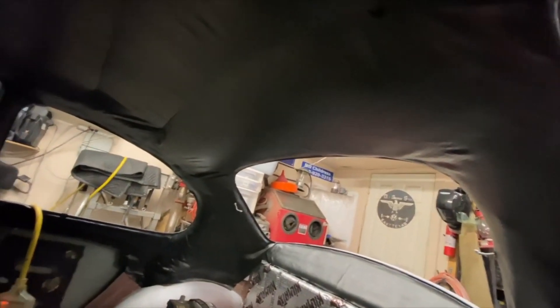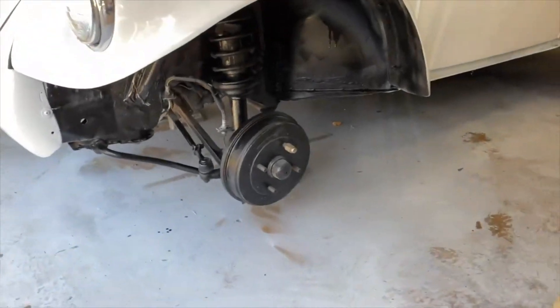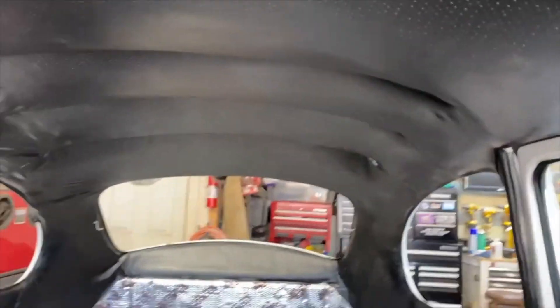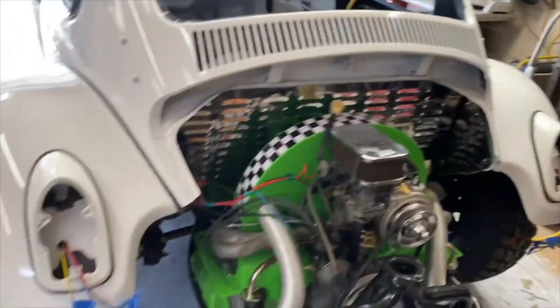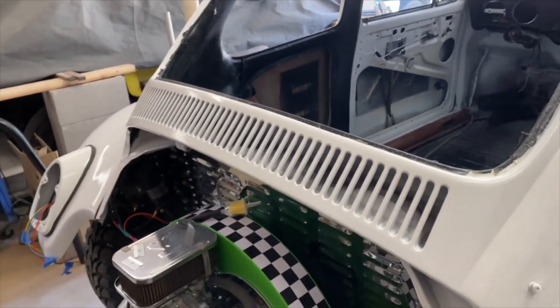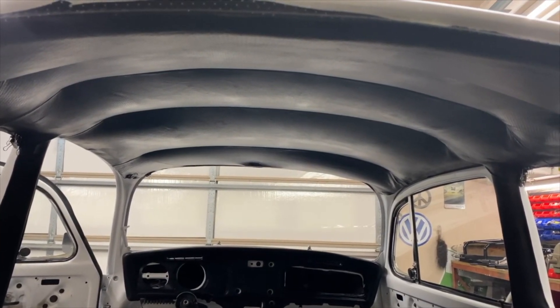It's slowly shrinking into place. For my very first headliner it's coming along pretty decent. I'm using a heat gun - just a paint stripper gun - and it's amazing, but you gotta be really careful because it'll burn the thing up quick. Just keep shrinking it, getting tighter and tighter. Also did a little painting down underneath the fenders, and got the taillights painted on the car. Turned out pretty sweet - now let's go to the windows.